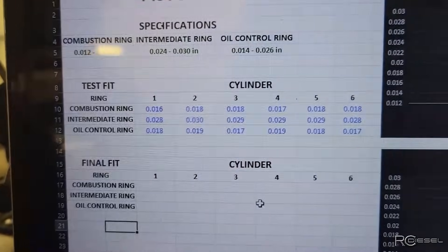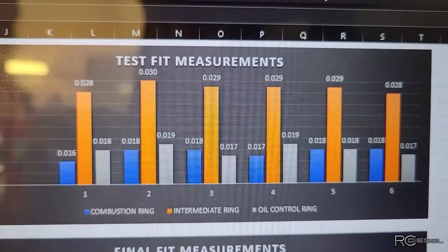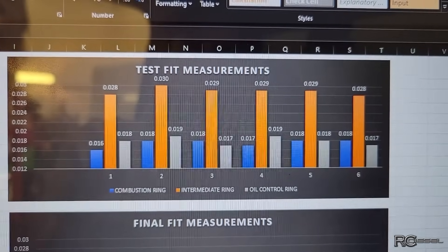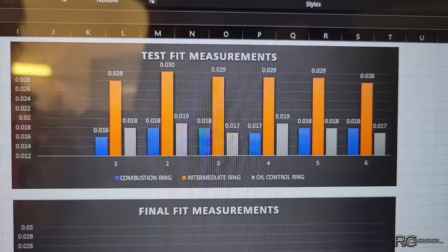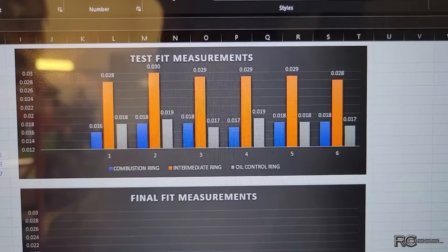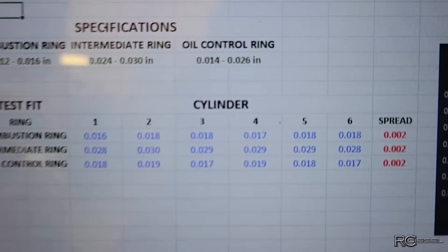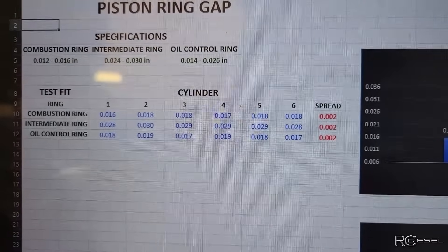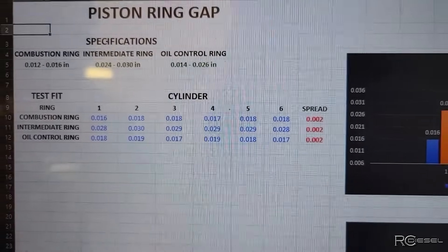That should make a nice running engine. There is a chart that shows what this all looks like. The measurements are not that far off — this is definitely one of the closer ring sets I've had. I usually wind up with one or two cylinders that are way off. This one's not bad, you could put it together the way it is and it would run pretty good. But we're going to bring this up to RC diesel standards. I got them all ground. The spread on all three rings was exactly 2 thou from factory — it's just amazing that manufacturer tolerance and the wear on those cylinders can give you exactly the same measurement on all of them.